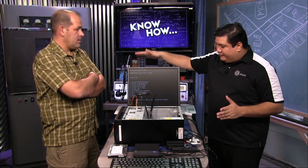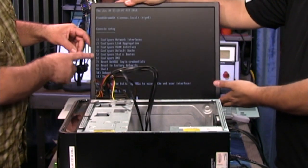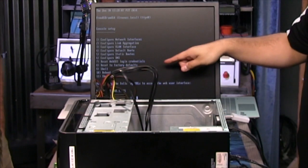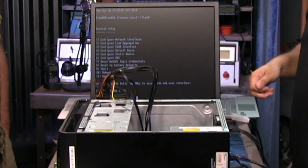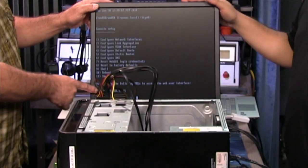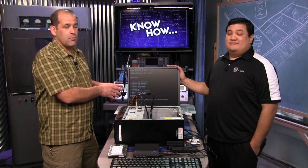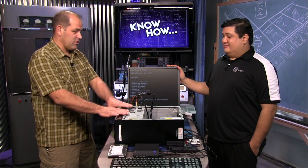Let's go into the NAS box. In the time that video ran, FreeNAS fully installed itself and gave us this interface. You won't get a neat graphical user interface — it basically just gives you 11 options, none of which you really need except shutdown. What you need is the IP address shown here. You can unplug the monitor and never use it again.